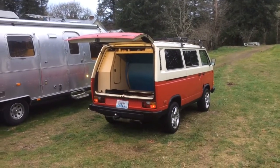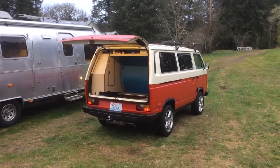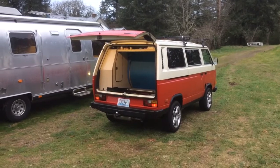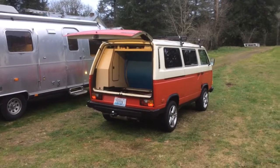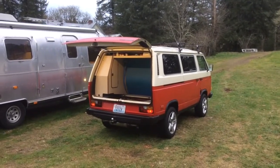This is an '83 factory diesel, so that's going to be cheaper than you can do a gas Vanagon, because the AHU just kind of bolts right into this pretty much. I mean, you have to do a bunch of stuff, but it's not nearly as much as a gas Vanagon where you have to get diesel-specific carrier bars and things like that for the motor.